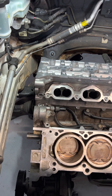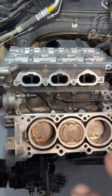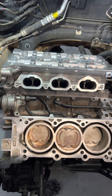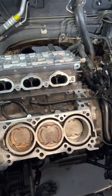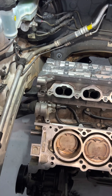Things to be considered when assembling the cylinder head bolt for this Kia Sorento 2014 — any V6 engine of Kia, including Kia Carnival and Sorento, it's all the same. As long as you don't put anything on the cylinder head bolt thread, you will be safe.